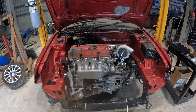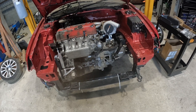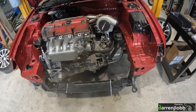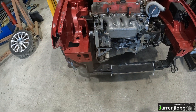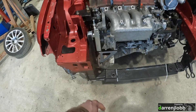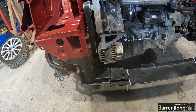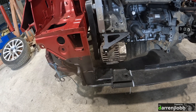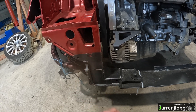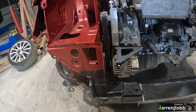Making good progress - the engine is bolted back in, all the mounts are on, the bottom one's on, clutch cable's on, got the two gear linkages on though I haven't got the right pins for that at the moment. I've bolted on the alternator with the auxiliary belt. Sam's got this relocation kit which basically moves the alternator down to the bottom where the air conditioning used to be, so it doesn't interfere with the radiator. It comes with a manual tensioner and a different pulley for the alternator to offset the belt slightly. We've got plenty of room and you can easily change that belt in situ, which is always a bonus.